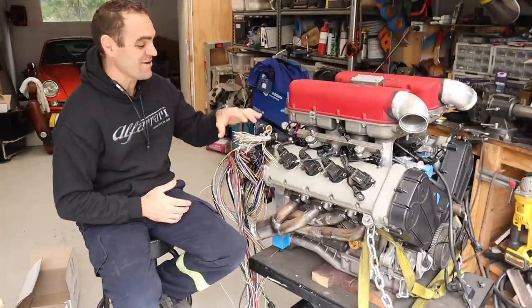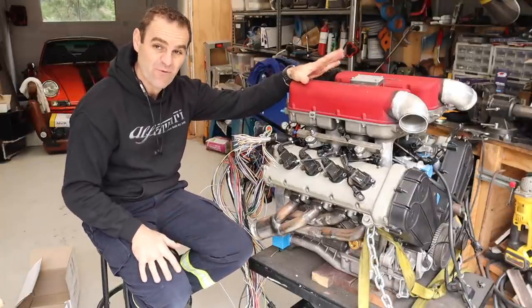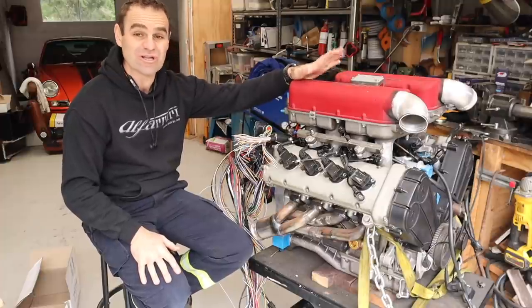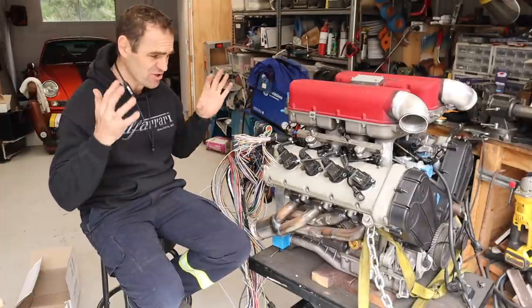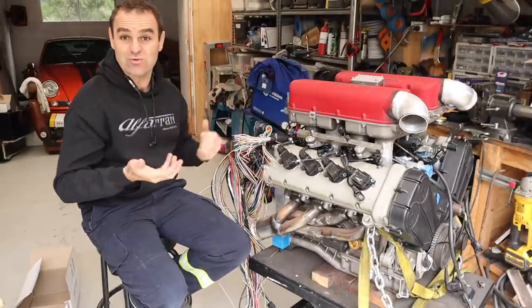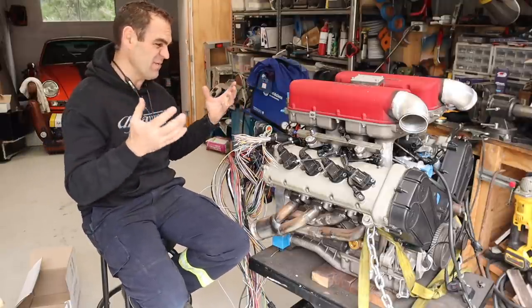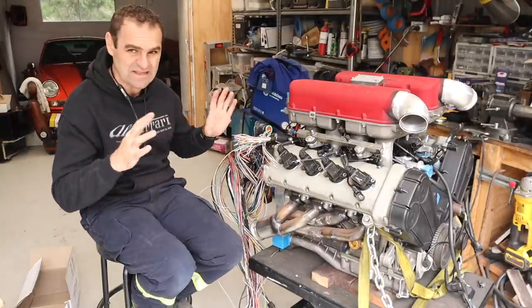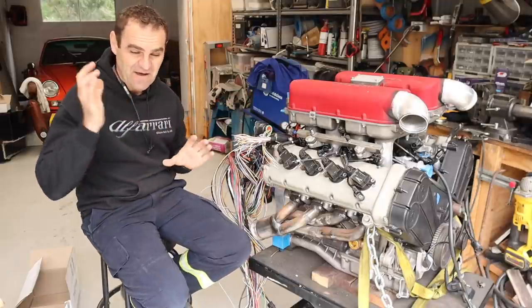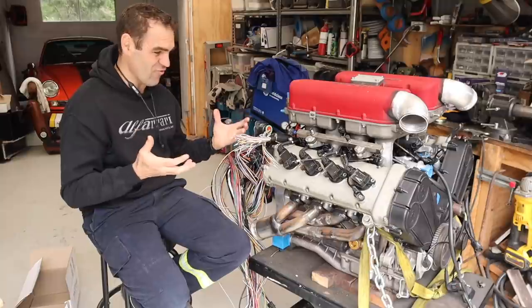Welcome back, guys, and those watching last week will have seen that I started rewiring the Ferrari engine to the Link ECU that I'm going to have running it. As I mentioned last week, the original Ferrari ECUs, which I have, are very primitive and they have an immobilizer, which is going to be difficult to get around, and I have to change things. There's too many things to actually get the factory ECUs to run, and they're quite old anyway. They're not a great design.